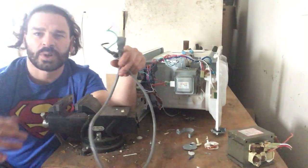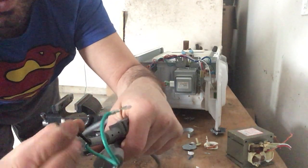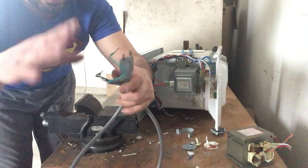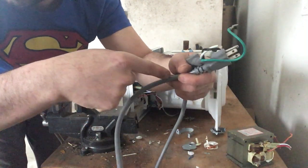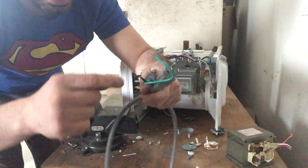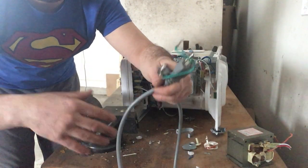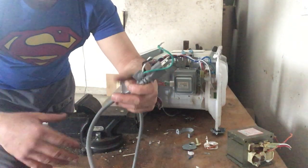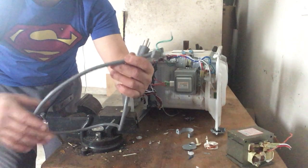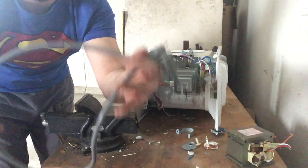Appliance wire has two categories: 40% copper recovery and 60%. Because this cord has an outer coating and three strands inside that each have additional coating, there is more plastic-to-copper ratio — so I'd get $1.21 a pound. Some people, if they have a stripper, will take the outer layer off so it becomes just one coating of insulation on the copper wire, giving higher copper recovery at 60%, which is currently $1.81 a pound. I would probably run this through my stripper because it only takes a second.